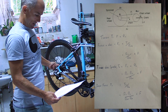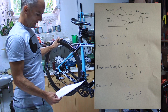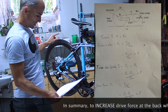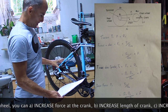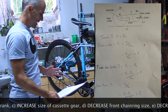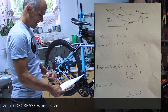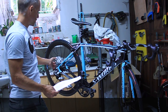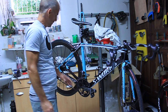It all makes sense. We then have to get the force that you're getting actually at the tyre on the road. That force is the torque of the sprocket divided by the radius of the wheel. We can see from all those figures that by changing the crank length, you're simply changing the mechanics of the system — you're not really doing anything magical. You can adjust any one of these variables to match different crank lengths by just changing gears. So there's no mechanical advantage in having longer cranks — you can simply adjust that using the gears.